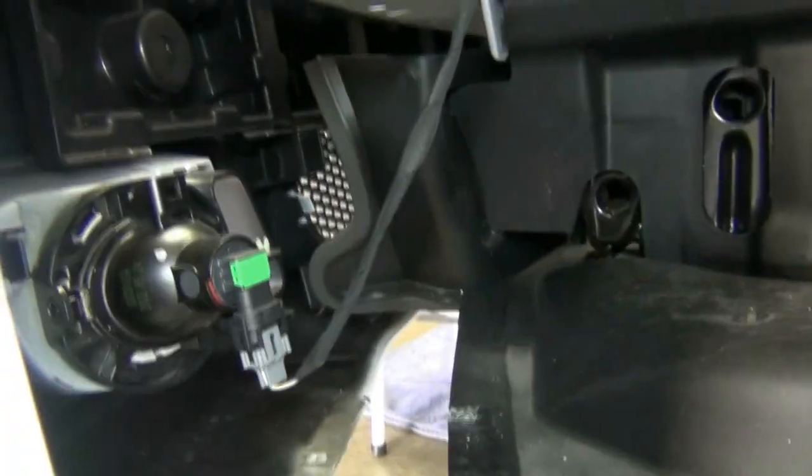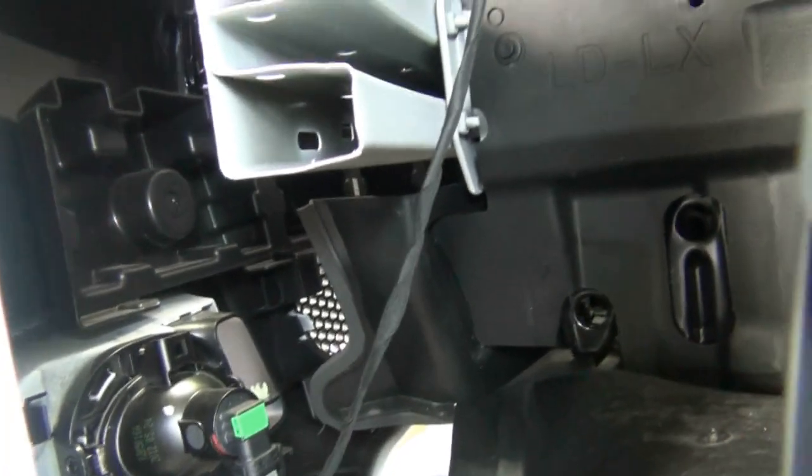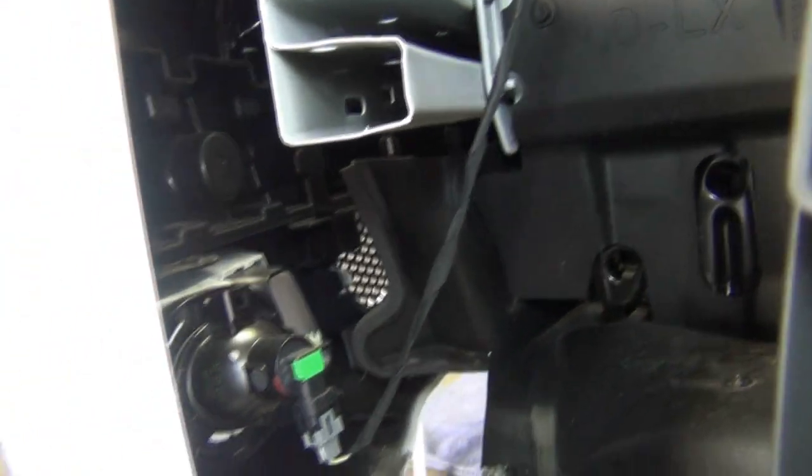You do want to watch your fog light cords here — they're kind of tight. I'm not going to move it too much; I may disconnect this, but I'm being real careful about the pressure on them. Then you've got five, six, maybe seven bolts along the bottom here. Just go all the way across and remove those, then do the ones on the other side, your other fender well, and then everything is loose.